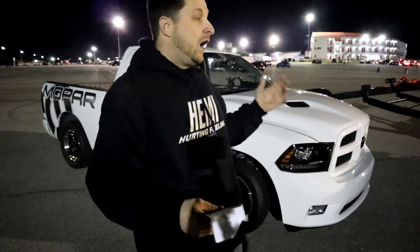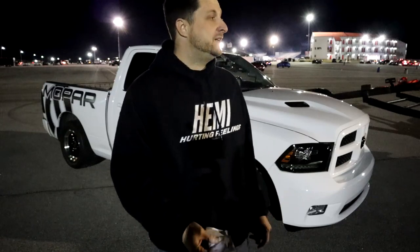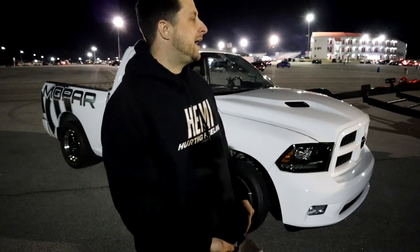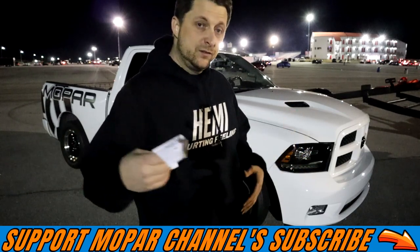Last year we ended the season with an 11.6 on the J Green tune at that point, and the 0.5 high lift cam I was running then. We ran 11.6, and this pass, first pass out, I just ran 11.8. Obviously, we don't have a lot of timing in the vehicle, so that will change. Once we get everything blended in good, granted, we've got stock pistons still, so we're gonna try to take it easy on it. But I'd like to see maybe 12 degrees of timing in it, maybe 12 and a half, I don't know, we'll see. With some race fuel, a little more timing, some better tuning in it, we'll see what happens. But this stuff takes time, so we're not far off. We just need some good weather and get the tune dialed in.